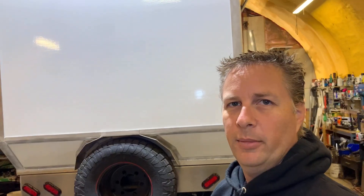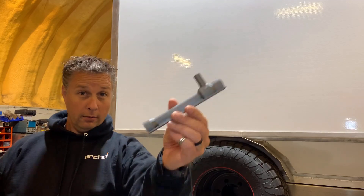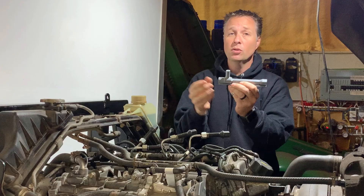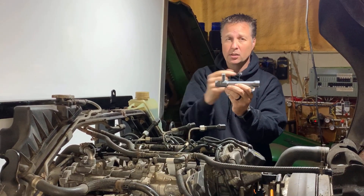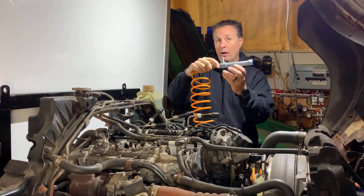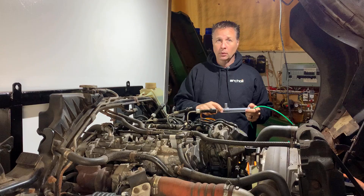We're going to make one — I mean, come on, what else would you expect? This is a 3D printed siphon jet, or eductor, or venturi. I didn't design this; I downloaded it for free and I'll put a link in the video description. This is going to be the basis of our tiny but powerful vacuum cleaner. Because this is a siphon, it uses high pressure to create low pressure — not a true vacuum, but you know what I mean. We can use compressed air as a power source and then connect a really small tube to go down into the cylinders and suck out the oil.